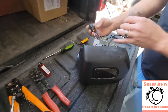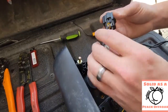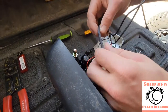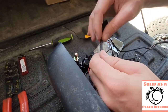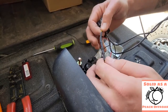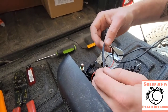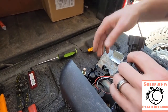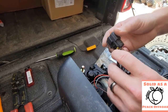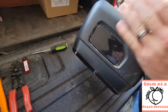What we did is: the brown wire going into the tail light portion is your running lights. So just take the yellow wire and the brown wire — I've already done it all up here — cut those two and bridge them together. Twist your brown and yellow together up here and your yellow and brown together up here, then lock them in there and put heat shrink around there, because these don't have rubber gaskets and there's going to be a little bit of water that gets in there. Once you do that, when your running lights come on your marker light will come on too.